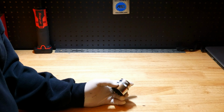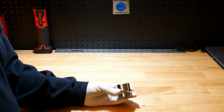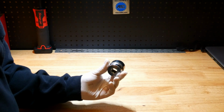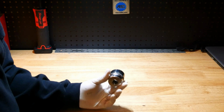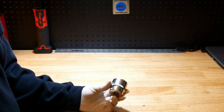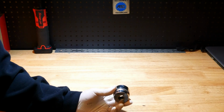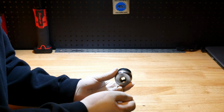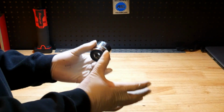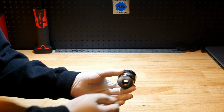And that's a great tip. That always works. I do that as well. But you could also use these to press in a part rather. I use these quite a bit when doing Toyota Camry cam seals, because a lot of times you may not have room with the hammer, because when you're doing a timing belt, a lot of times the cam is so close to the body that there's no way you could get a good swing on it.